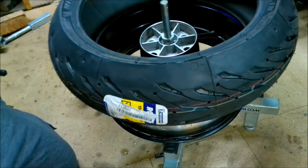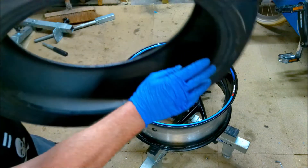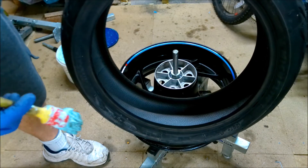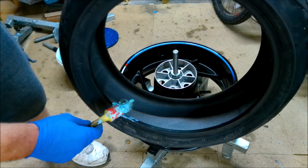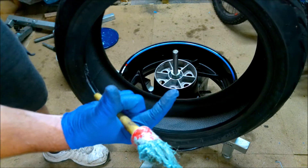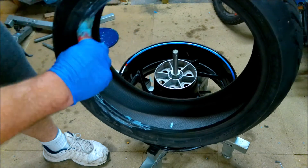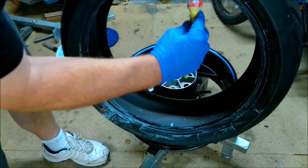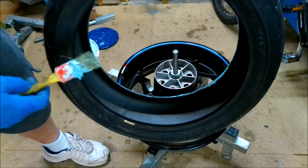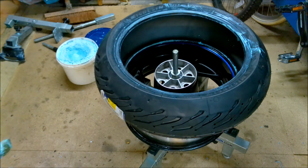Having got the rotation right, next thing to do is put a bit of soap around the inner edge to make that slide on beautifully. You want it on that inner edge - it's going to slide over the outer edge of the wheel and then slip back up onto the bead to seal the edge of the tire. It really does make a huge difference to have the soap on the sidewall. While the tire is off I like to get both sides done. I've heard that the soap actually helps seal the outer edge - it gets into all those cracks and then sets.